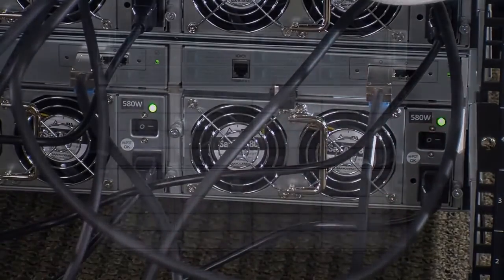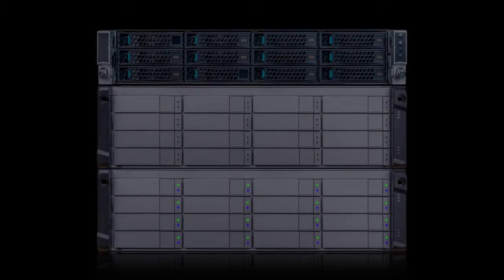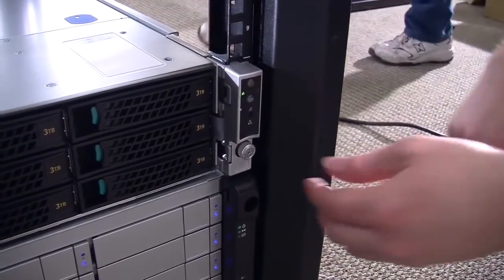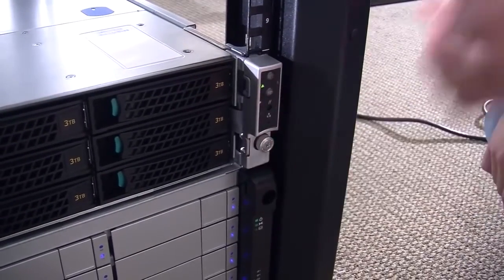Watch the front panel of the storage shelf and wait for all disks to initialize. When all of the lights on the unit stop blinking and are on steady and no faults exist, you may power on the next storage shelf in the chain, each time waiting for the storage shelf to initialize before continuing on to the next storage shelf. When all storage shelves have been powered on, you may power on the 5230 appliance by pressing the power button located on the front panel.